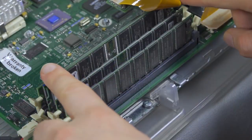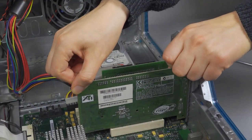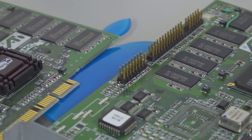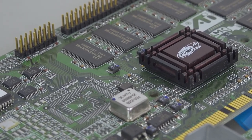We'll up the memory from 704MB to 1GB, because why not? I'm also going to replace the graphics card, as I noticed some interference. Interestingly, one has a little heatsink and a slightly different number on a sticker. I later read that there was a slightly faster revision of this card, so that's probably what we're seeing.